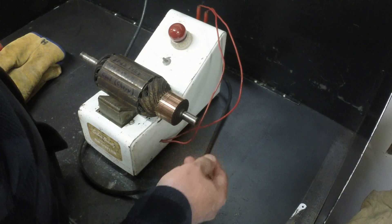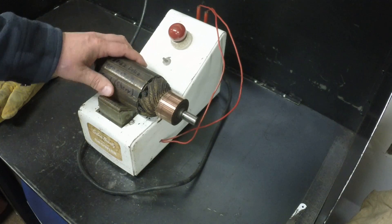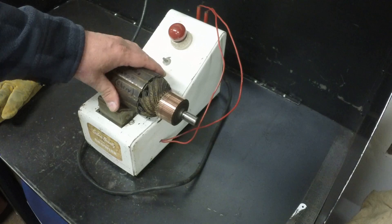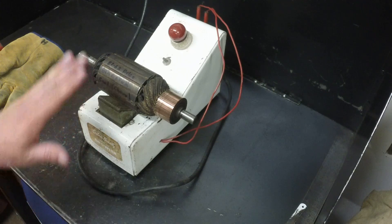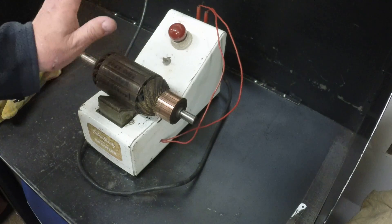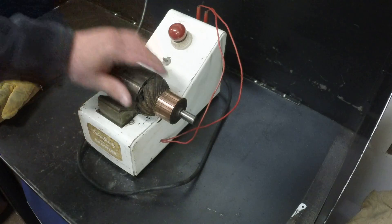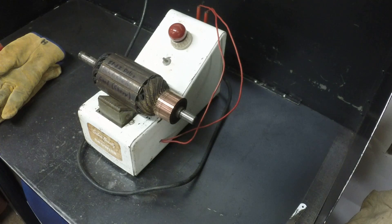I do have a 59 armature around somewhere. That's how you test the armature for any old Delco DC generator or starter motor - starter motors are direct current, the armatures are direct current. That's how the growler works. This again is a Silver Beauty model 440 growler - I picked it up at an estate sale very inexpensively. They're hard to find but it's an easy way to check armatures for your starters or generators - it's not the only way to test them but it's quick and easy. I hope you enjoyed my video on the growler and testing a generator armature from a 1960 Delco Remy Chevrolet generator. Thank you for watching.